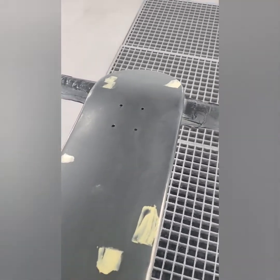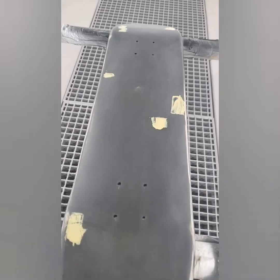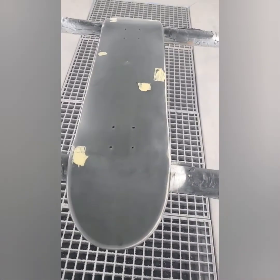A lot of guys are opposite, just because they think the base coat sands better. Me being at work, and if I had to sand the sealer that I use at work, we use BASF Diamond, and it kind of tends to gum up on a DA, or if you're doing it by hand. So I use a little bit of wax and grease with it, and it does really, really well.